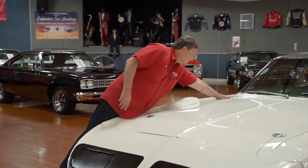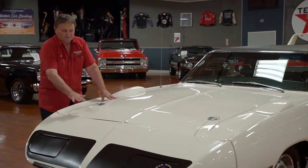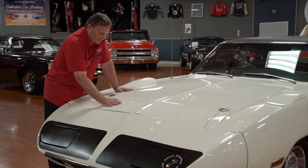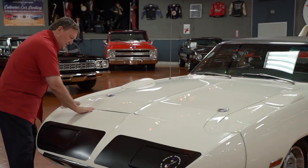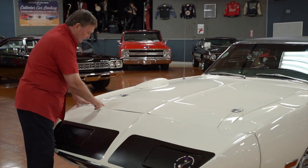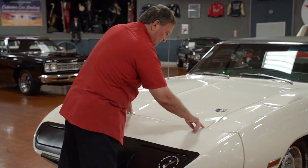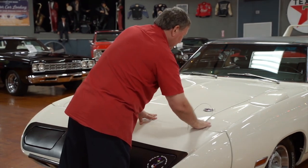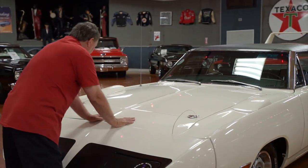You can see the fitment of the hood up to the cowl area and the fender — this is all different than a standard Roadrunner, completely different. The fitment is as nice as can possibly be. A little bit high on the very nose piece here. The gap is about an eighth of an inch, a little wider here at about a quarter inch, going narrower down to an eighth and three-sixteenths, then back to an eighth down the side. It has the correct style cupped hood pins, stainless steel the way Mopar made them.